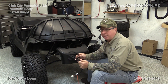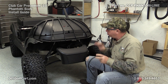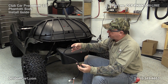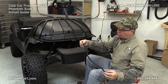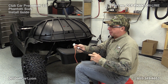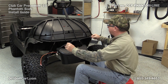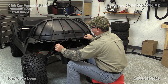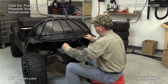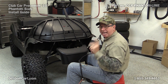With this phantom body kit, it also comes with headlights. So what we're going to do is some pre-wiring so that it will be a lot easier — we can set the body on, put the lights on, go ahead and reach in and plug everything up. This is one of the harnesses for your headlights. We're going to center this up. You've got the end of your corrugated tubing here, and the other portion that'll plug into your light. We're going to run this eventually into the dash on the passenger side. We want to put it centered to the front cowl. That way, with the little zip ties that come with the kit, we can take this corrugated tubing, zip tie it to this cowling using the holes that are already there, and keep everything tucked away and nice and quiet.